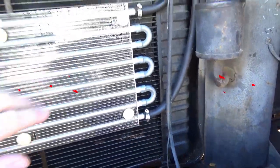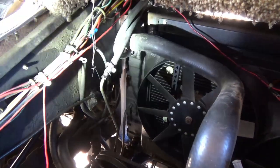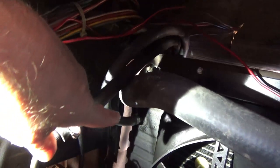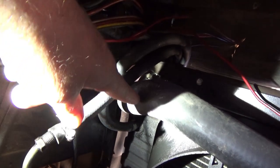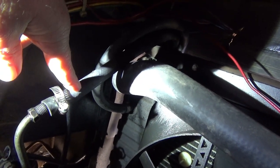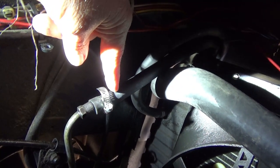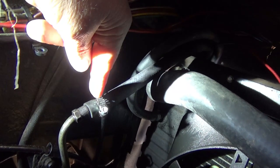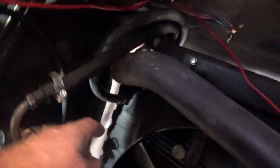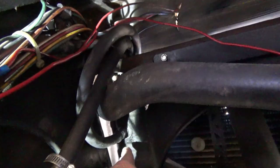Here's the inside view. Over here are the lines coming in from the cooler — one goes to the top of the radiator and the other goes to a line that was connected at the top of the radiator. It's just a nut with a flare fitting, so I crammed the new hose over it and put the new hose clamp that came with the kit on there. The new hose was just cut to length from what came with the kit.